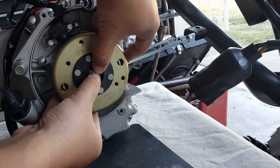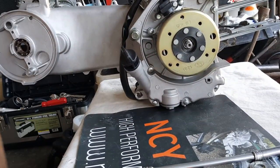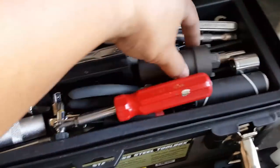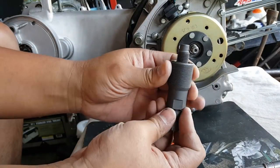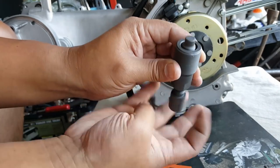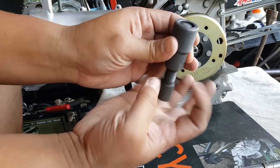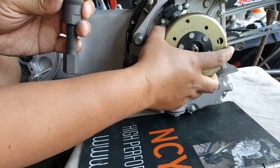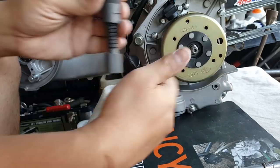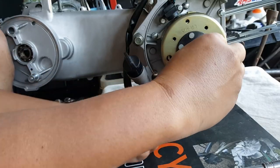This thing will not come off by itself — it's stuck on there by magnets, so it's very hard to get off; you can't pry it out. This is where the special tool comes in: it's called a flywheel remover tool. It's reverse thread, so lefty-loosey righty-tighty doesn't apply here. If you move it to the left it actually screws into the housing. We need to retract it a little bit because we're going to put pressure onto the crankshaft stud and force the flywheel out. The only thing holding it right now is magnetic force — it's just a solid piece of magnet internally that spins around. We'll retract it about a good inch, then turn it to the left.